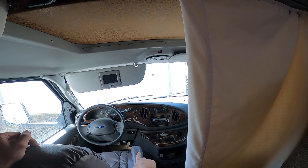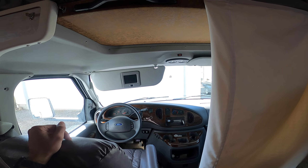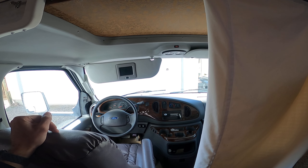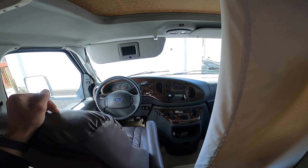You can start the generator from the cab as you're pulling up if you want — you should let a generator run for a minute or two before putting a load on it. There's also a switch next to it called Battery Boost. If the van battery happens to die, you can press that button and it will link up the house batteries so you can jump-start yourself.